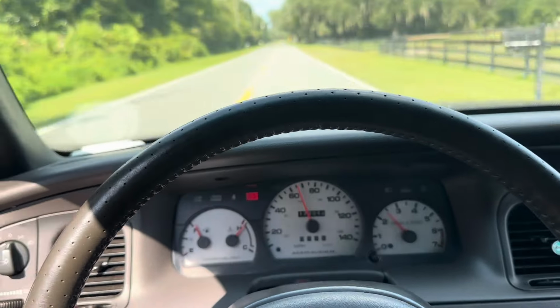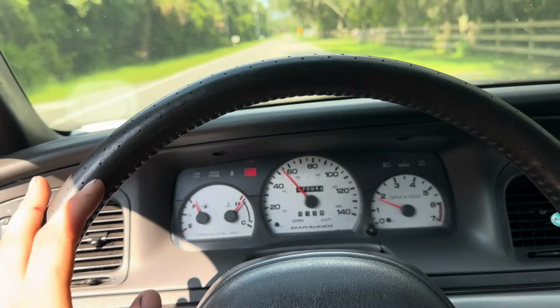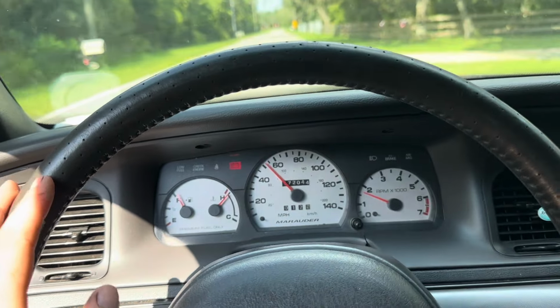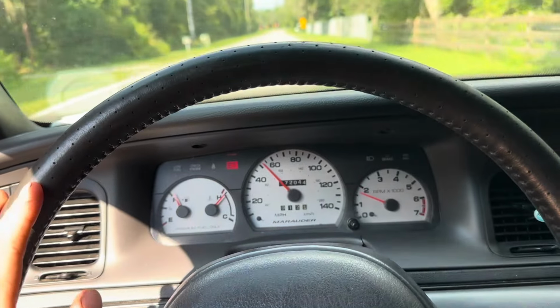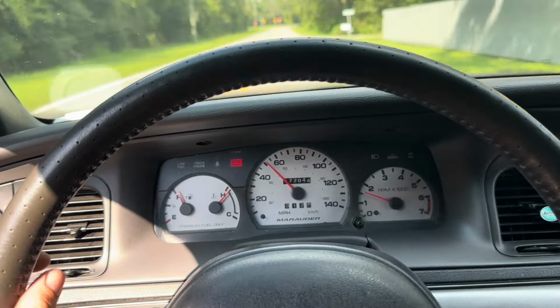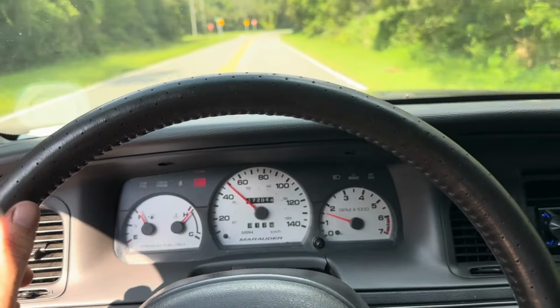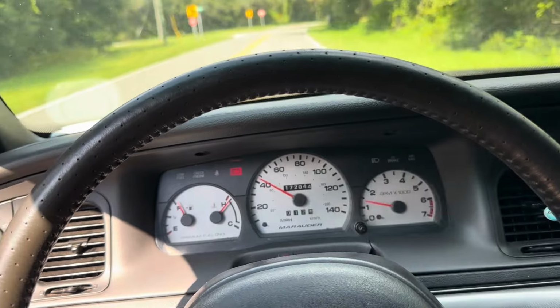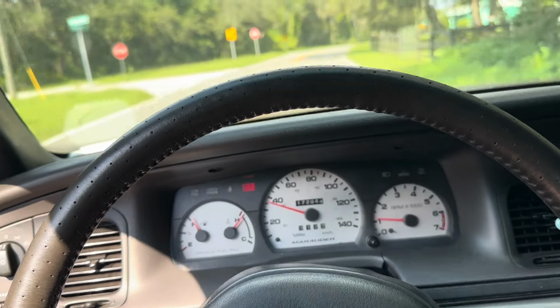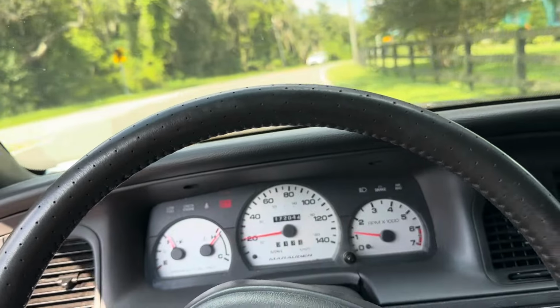It's not bad. I threw a new tune in it, a new O2 sensor, new tune. I added a transport delay for the stainless works headers, and it seems to have responded pretty well with that. I only added about 3 degrees total, so it's probably still pretty soft tune-up wise, but it does seem to run pretty dang good. This thing really needs some AC, so we don't have any AC stuff hooked up.